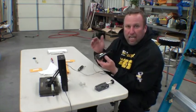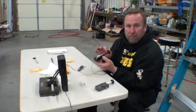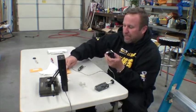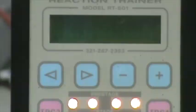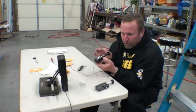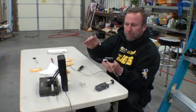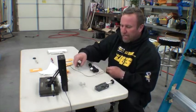One try — this is not like I'm recording trying to get a good one, I'm showing you exactly live. This should be around 535 to 545. Result: 563 — I'm human, I didn't hit it that great, but it's okay. Going again — 546. Now going to the 35-45 spring. This should be 35 to 45 right here — 48. So right there, all I've done is change this spring and I went from 15-25 to 48-50. It's slowed two and a half hundreds right here on this one spring.